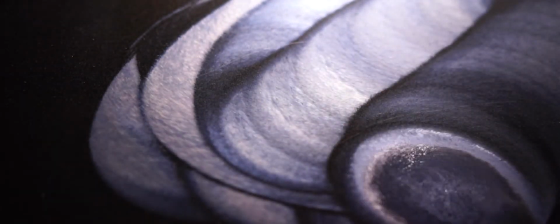Now again, we're not expecting the 2 marks either side of the area that we've sanded to have any correction. We purposely didn't sand those 2 marks so we can see how much we'd re-level them just with polish, and we want to see how many imperfections have been removed from the area we've wet sanded.